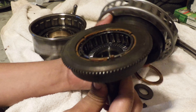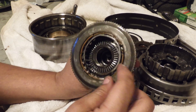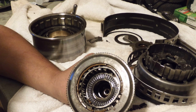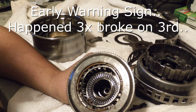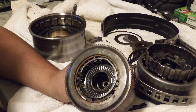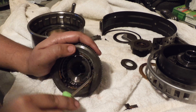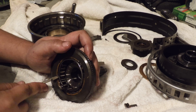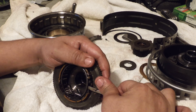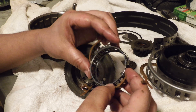You can tell this is how it pulled out. I can't even put it back together because the sprag is so bad. All right, but just to show you — here's the problem. If you're having a problem where you don't have any forward or reverse, or if you floor it and it feels like the car just automatically goes to neutral and it just revs, and then maybe you cut it off later and it drives normal again — this is the problem. There's the overdrive sprag, what's left of it.